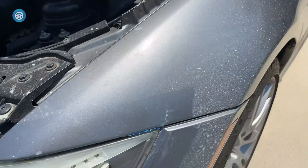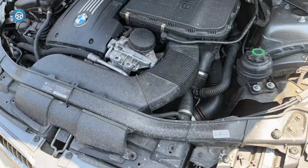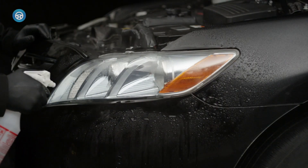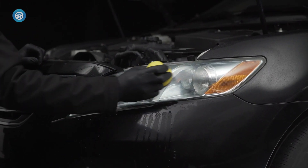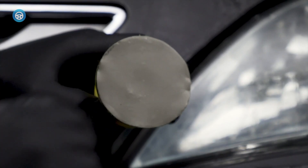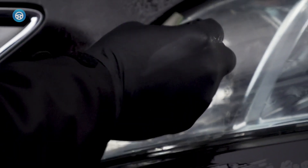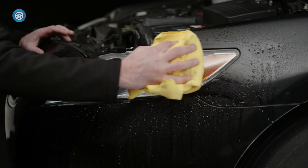The only items you'll need to supply are painter's tape, gloves, and a microfiber towel to dry your newly shined headlights. 5. Cerakote Ceramic Headlight Restoration Kit. Cerakote offers the best headlight restoration kit if you're looking for a ceramic coating that not only protects from UV light but can also restore light output on highly oxidized headlamps. The kit uses a three-step process that begins with an oxidation removal wipe, followed by sanding, and finally, after washing and drying your headlamp, you wipe on a durable ceramic coating to protect your car long-term. It's a great product for someone who enjoys the hands-on experience of a DIY project.